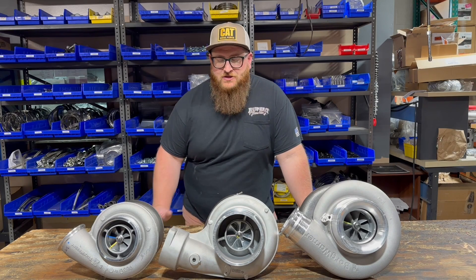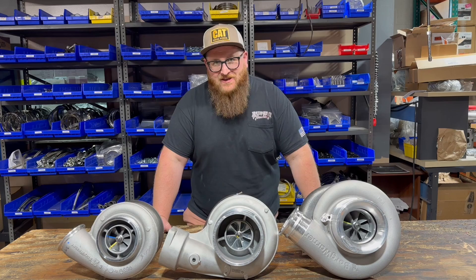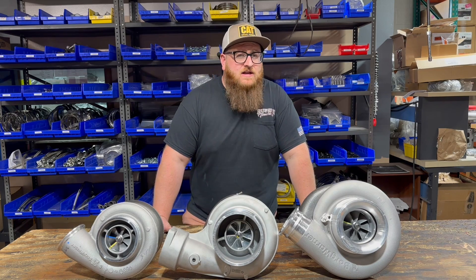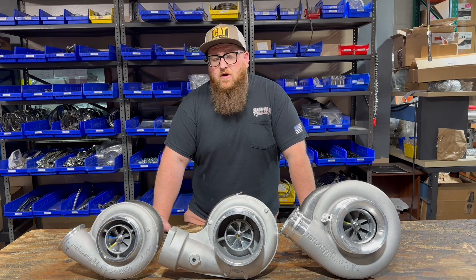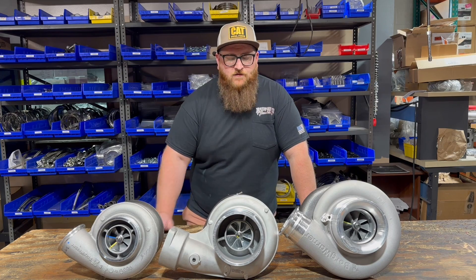While we've covered in depth the strength of running an S400, S410, or S500 in multiple other videos, we're not going to talk about that today. What we are going to talk about are the plumbing changes you need to make — your oil feed line, your oil drain line, your air cleaner inlet, your exhaust outlet, the manifold footing — all those touch points where the turbo connects to the motor.